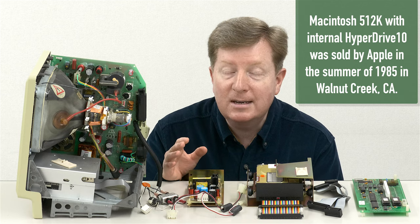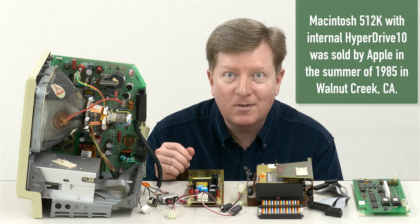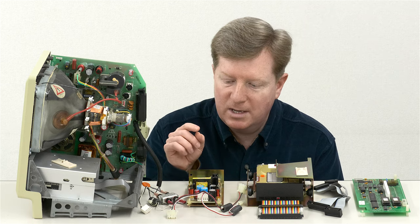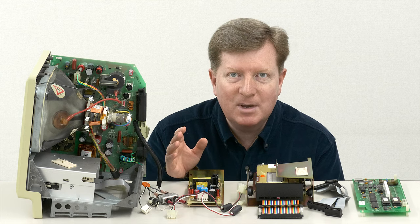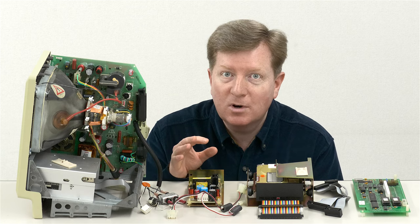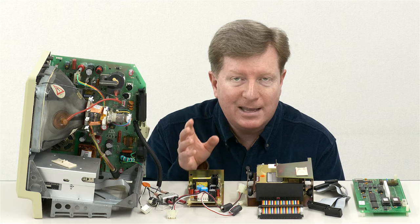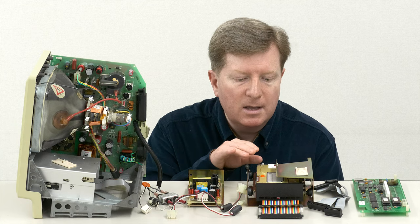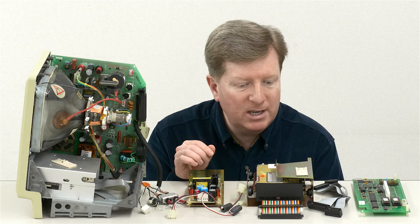The original owner told me he never had it serviced or upgraded, and when I received it in 2007 it booted up just fine. I've also done extensive testing in making this video to confirm it still works. I should mention that through the years on the 68K MLA forums and even speaking to GCC people who worked there in the early 1980s, many told me the drive was either a Rodime or a Mini Scribe — but that's not true. A later 20MB Hyperdrive used a different mechanism, which misleads people. As I described in part 1, this is a Microcomputer Memories hard drive, a lesser-known brand that does appear in sources like the Hyperdrive Bible.